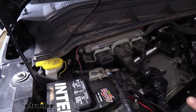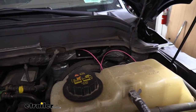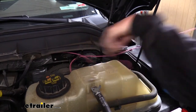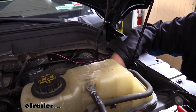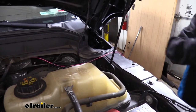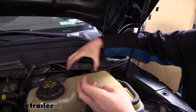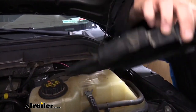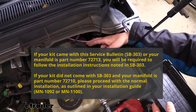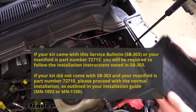Last we hook up our pink wire. That wire went up and then stayed underneath at the top of the firewall all the way across, poked behind the heat shield to keep it out of the way. From here we go to our fuse box, which is located right over here behind the coolant reservoir. The fuse box cover just pops up — the two release levers are one on each side, give those a squeeze and pull up to release. Now that we've got our fuse box exposed, we're going to tap into one of these fuses to get an ignition source for our pink wire. When we turn the key on, it's going to power up this pink wire, tell our system we're ready to go, and it's going to check our pressures before we leave.